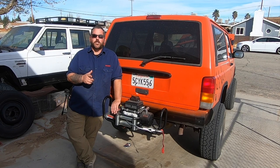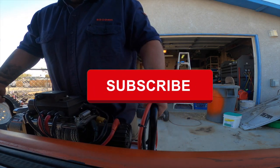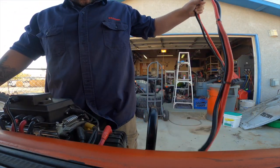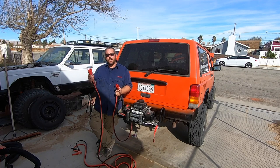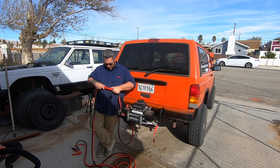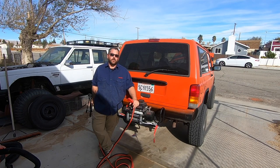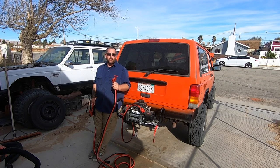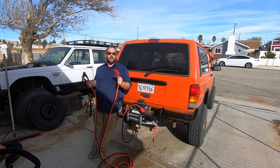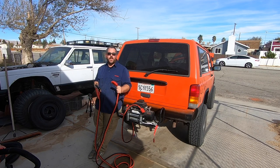If you're new here, welcome to my channel and don't forget to subscribe. Off my winch I just have a plug — it's really nice. I'm gonna run a plug off the Jeep so whenever I slide my winch into the hitch, it's as easy as that and I have power. I'm gonna power to the back using a plug like this one here — good for running heavy gauge wire for your winch. These plugs are also useful for jumper cables: plug in the back with a set of jumper cables and you can jump somebody from the rear, or put one in the front and you don't have to pop the hood.